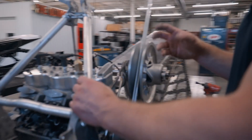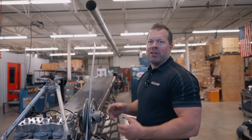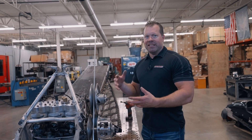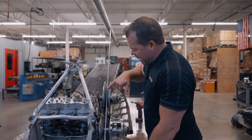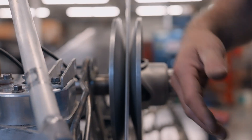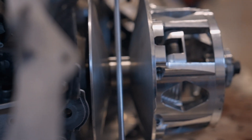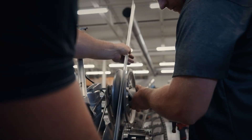When we're dealing with aligning clutches, everyone knows there's a clutch alignment tool you can set on there. Well, when you're mixing and matching engines and clutching center-to-center offsets, there are some simple tricks we're going to show you. We have an extruded straight edge in here. We open up the clutch, set it in there, grab onto it, lay it perfectly down and it goes down just about to the center. If you really look at it, you can see it's offset a little bit towards the engine — we do that to compensate for belt deflection.